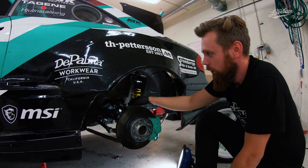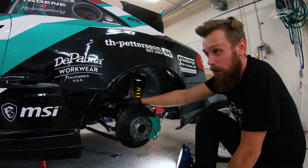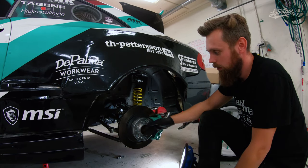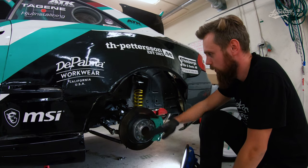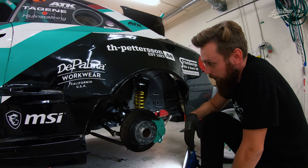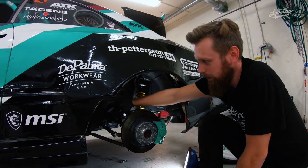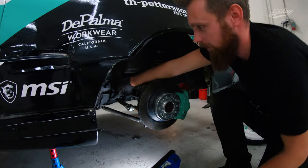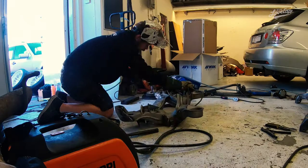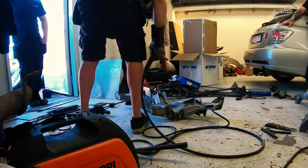We're using uniball arms for everything in the suspension, and all of these arms are about seven centimeters longer than the stock ones. That's how we've widened the track of the car instead of using a huge spacer, which would mess up the rear suspension geometry. We're using a stock subframe, but we've put a lot of time and effort into reinforcing it. You can see this small bracket — this is one of the reinforcements. Each single pickup point of the subframe has been reinforced to take all of the load that the grip of this car puts through it.